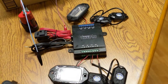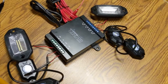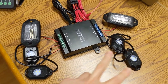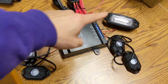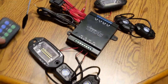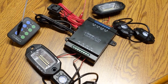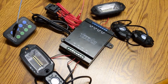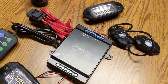Let's take a look at how this works. I have 6 lights hooked up to it right now — these are the lights I'm going to run with the Blazer system, but not in this kind of crazy wiring fashion; this is just to demonstrate how all the different channels work. In reality I'm going to have all four rock lights hooked up to one 3.5-amp channel and the two flood lights hooked up to a 5-amp channel. Right now I just have 6 channels wired up to show how everything works. I've left the 20-amp channels empty because I just don't have any more lights.